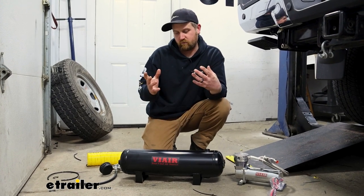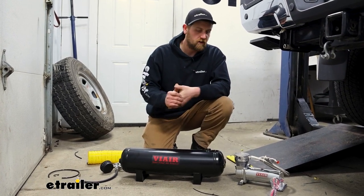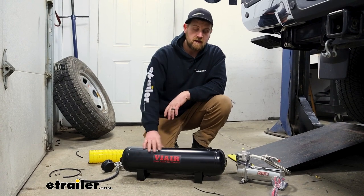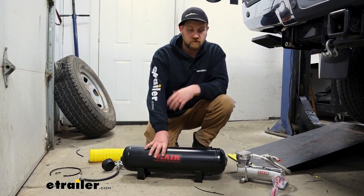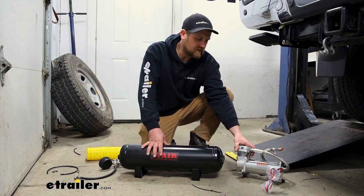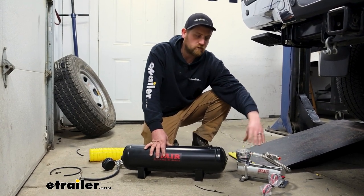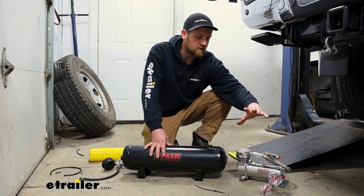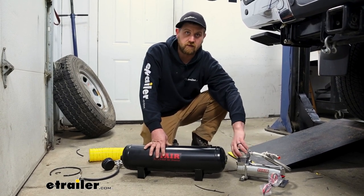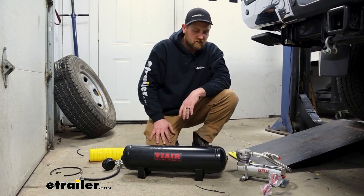In a minute we'll put everything through its paces and see how it works — maybe air up a tire, air up the bags. But I just wanted to show you what's going on. The kit is pretty stout: two and a half gallon tank, and the setup has a 200 PSI maximum working air pressure, which is really good. The compressor is no joke — it will move quite a bit of air, I believe it's 1.86 CFM. But more importantly, it has a 100% duty cycle at 100 PSI. More or less what that means is at 100 PSI it can run for an hour straight before it needs to cool off. That gives you a lot of runtime at a pretty high pressure to do what you're trying to do with it.